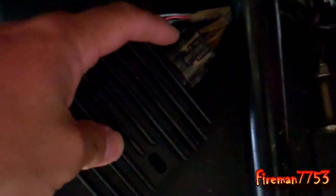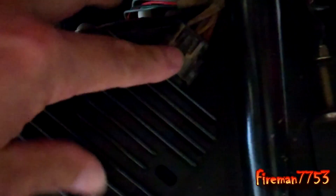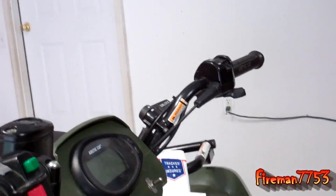An important thing to note because this is a waterproof fitting — make sure that you push hard until you hear that click, and make sure it's seated properly. If you don't, you're going to get water in the unit and then you'll get to buy a new one. So before I hook this thing all back up, I'm going to go ahead and hook my battery back up and make sure this thing fires.